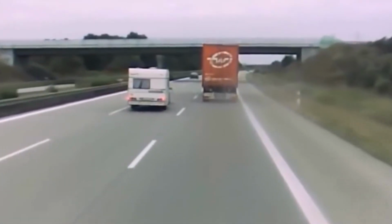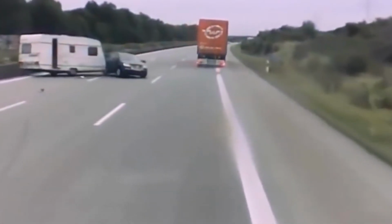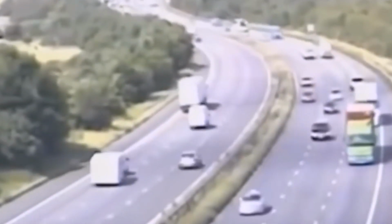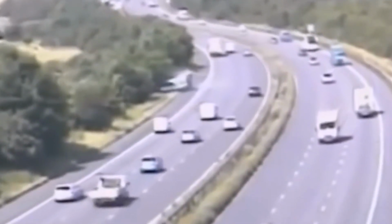The difference between snaking and jackknifing, I would say, is that snaking leads up to a potential jackknife. Snaking is where the trailer, the caravan, starts to oscillate and becomes out of alignment with the tow car. Quite frightening. You're looking in your mirrors and it's swinging from left to right and back to left, out of control. If the driver doesn't take some positive action and do something about it, the likelihood is it will be completely out of control, a crash will result, and the jackknife finishes it with the caravan, the trailer, next to the car or on its side next to the car or forward of the tow hitch.